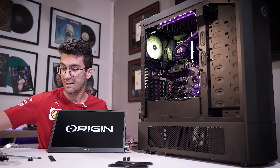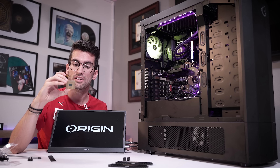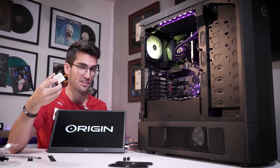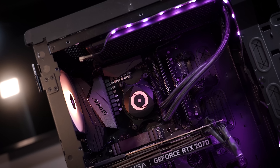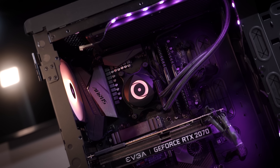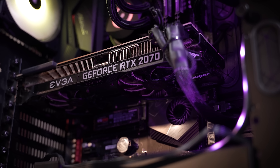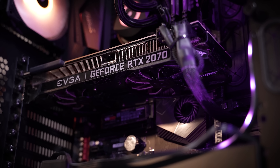So he had a cooked CPU. I want to run a few more tests, but first — just to be sure — I've got all of his original hardware back in: his two DDR4 modules in the correct slots this time, his 2070 Super, and the same cooling setup. Everything is all wired up. And there we go — that is a post. A pretty night and day difference. Unfortunately, this little guy here is to blame.